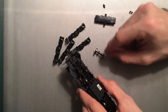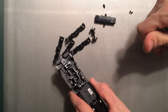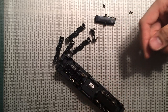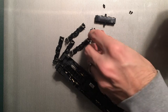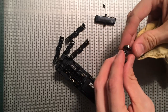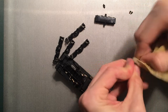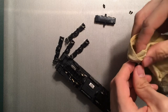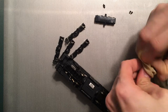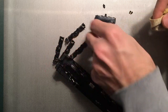What I'm going to do now is go through and clean these — clean each one of these and clean the surface contacts. I won't do it all in the video because it is kind of time consuming, and nobody wants to sit and watch somebody clean some wheels. All I'm going to simply do is just go through and clean the tread. Use a little alcohol on your rag, and then I'm looking to clear the face of this. I'll do all the wheels that way.